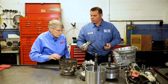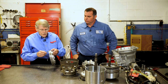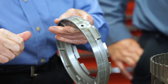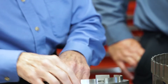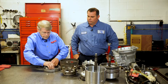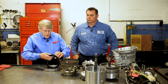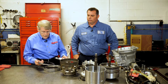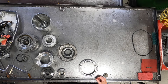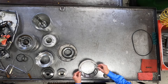Here in our center support is our only bonded piston — everything else is D-ring and O-ring. This is actually where the case seal hits, so make sure that case seal is in there or you're going to have big time problems. This stationary brake is for the C1 clutch. This is the only bonded piston in here. It does have an apply ring that sits on top of it as well as a Belleville, and make sure the Belleville gets installed the correct way, which means the dish goes up.